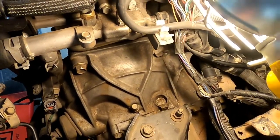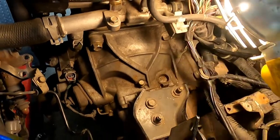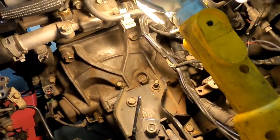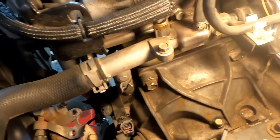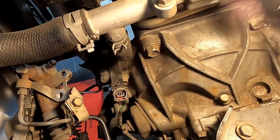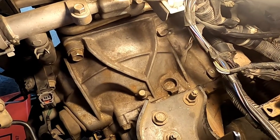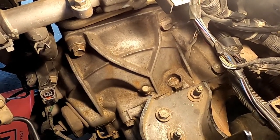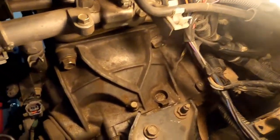We are actually going to start breaking some bolts loose on the transmission itself. I have already broke these three loose on the transmission. I've just broken them loose. I barely turned them just a little bit, to make them come loose. And we're going to start working our way around this thing. I believe those are number 17 or 19? You think those are 17, 19? What are we thinking? They're 19. So, 19 millimeter, we're gonna go around, grab all these, and then we're gonna tackle that